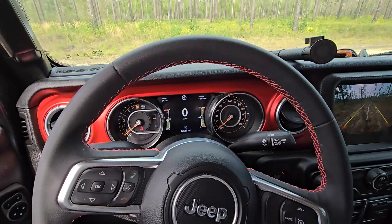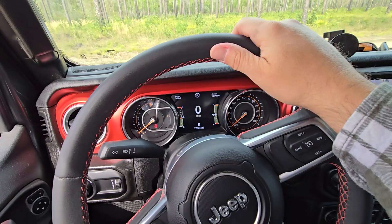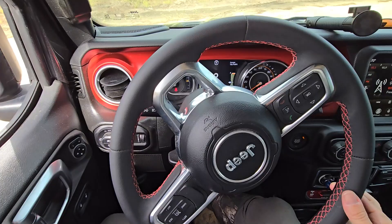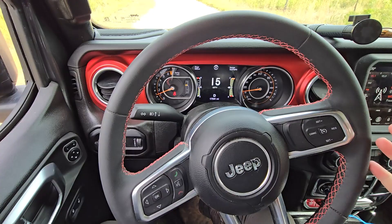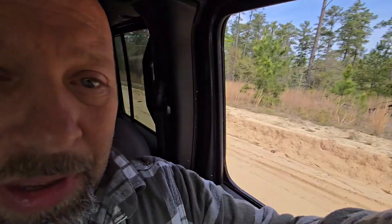Four high is definitely an easy-peasy kind of thing. You'll also feel that bind in the steering wheel. I'm going to turn the wheel all the way and hold it loosely so you can watch it bounce and jump as the wheel skips. See that? That's the wheel bind, that skippage. That is normal stuff, but the less time you spend with your wheels cranked all the way left or right the better. A pretty hard turn makes you crank all the way — you can still do it, but it's much gentler on the truck and tires when you avoid that in four-wheel drive.